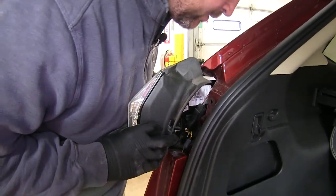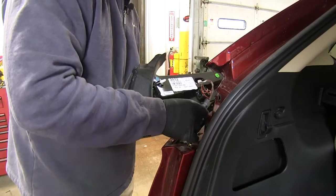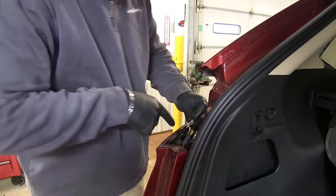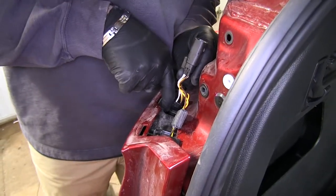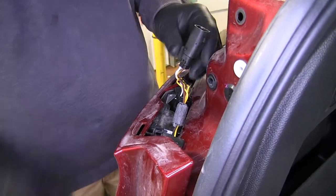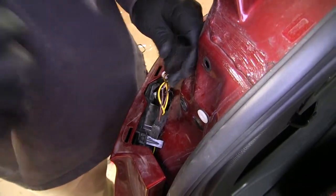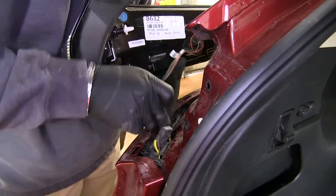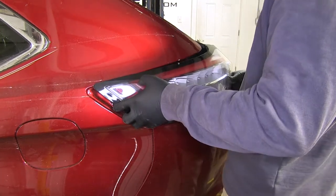If you're having a little trouble with your wiring where it's made the connection, go ahead and take it back off. Down inside where your factory wiring is connected, there's a little white fastener. Disconnect that or pull it off, then push this whole wiring harness down inside there — a flathead screwdriver works great for that. Get your taillight plugged back in, push your fascia back into place, and reinstall the taillight.